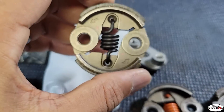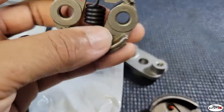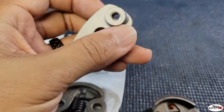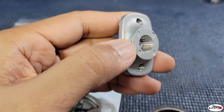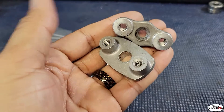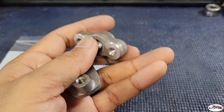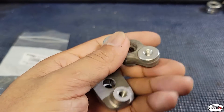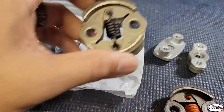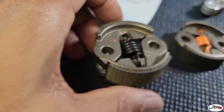The CY clutch shoes have a 9 millimeter hole. How this works: you bolt it up to a clutch plate, which attaches to the crank of the engine. There are different types of clutch plates — RB Innovations and Taylor RC both make a cooling clutch plate to help keep dust out and cool down the clutch. Heat is the killer of all clutches and will wear one out really fast. You mount the shoes right here on the plate like so.